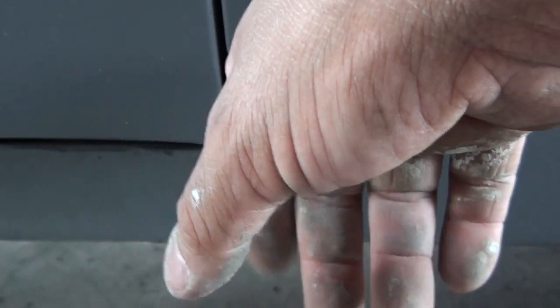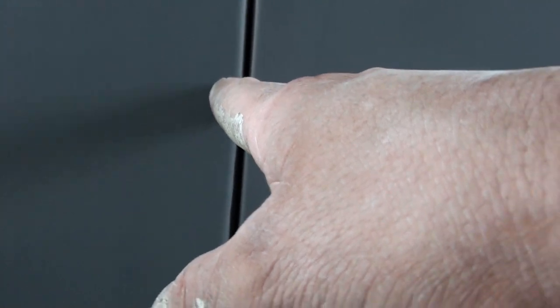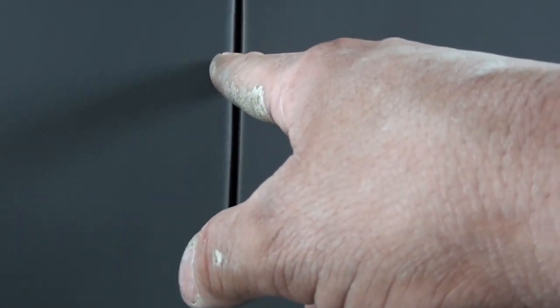This crack right here is not actually going to be a crack when I'm done — this is going to have the body line that it's supposed to have, which I didn't put back in the last time I fixed it. I'm going to take some 80 grit by hand and put my line in it. It's just simpler to get this stuff to mate up if you bondo it shut. I literally took my bondo spreader and bondoed this door and this fender together — pretty as please. It ain't quite a quarter inch thick, probably more like an eighth, but it's put in right so it'll stay. I used fiberglass short strand for the first coat, which is pretty tough.